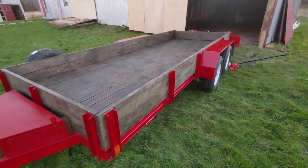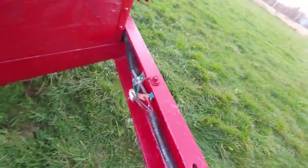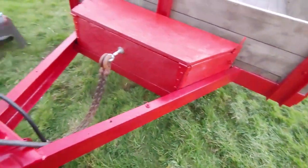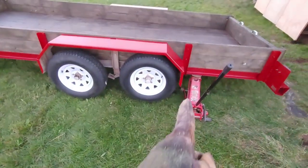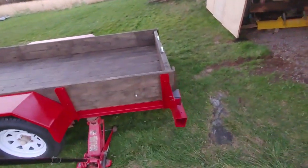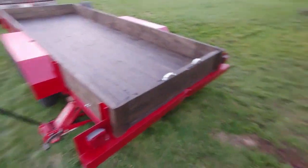All the lighting works well. I replaced a broken tail light cover with a spare from my shed, put a new grounding cable on, and tucked in and screwed all the wiring to the rail so it's not flying everywhere. All I have to do now is take off the jack. I still need to get it registered for Nova Scotia — it's still registered for Ontario — and I haven't been using it much out here.